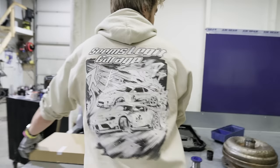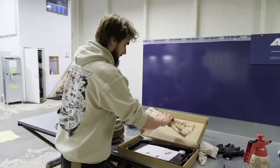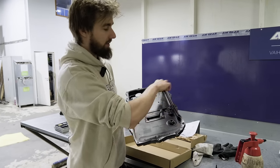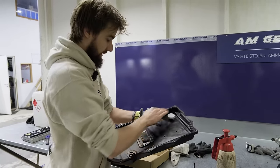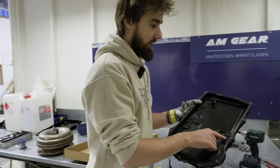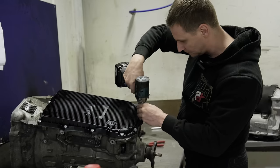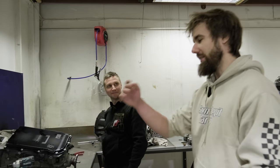We have the new oil pan in here, which is a sump and the filter joined all together, with the extraction that we don't need, a set of bolts, and the pan itself. There is no need to add any silicone around — don't seal it up, it has its own original seal. Just make sure that it sits nice in the groove all around. Inside you can see there is a filter and magnets that get all the metal shavings stuck to it. Get it lubricated so it goes in nicely. And that's it — the next thing, it needs to go into the car.